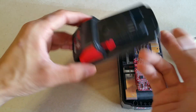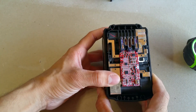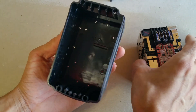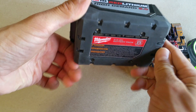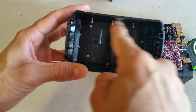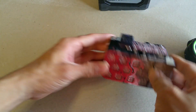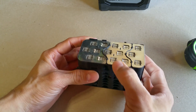Because you can see there's no seal or anything, this goes for any battery — water can get in, especially if you have your light or drill out in the rain. But if water does get in, it needs a way of getting out. That's where the drainage holes come in. The rest of the case has drainage holes along the bottom, so it's completely open. Those four screws are just perimeter drainage holes, breathing holes — whatever you want to call them. That's essentially the shell.